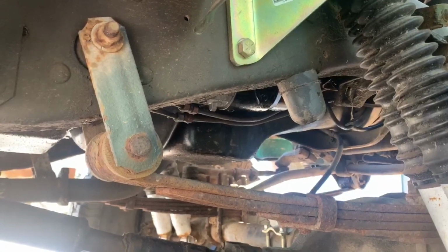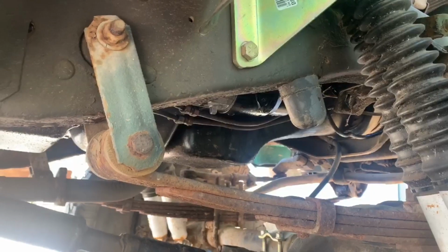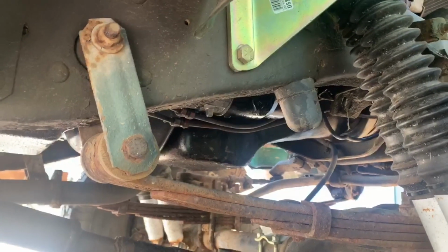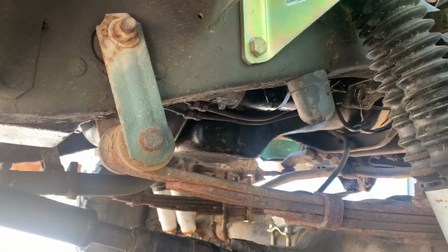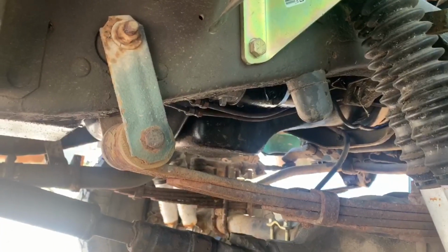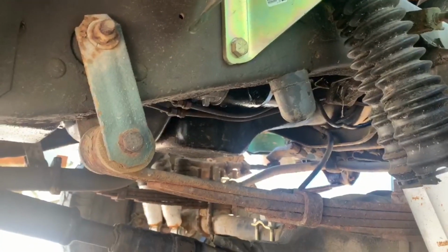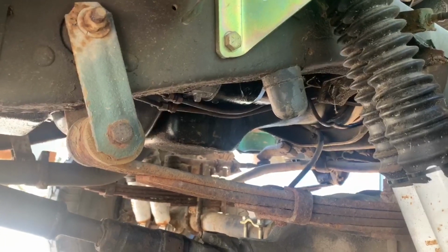When the starter was remanufactured, it wasn't put together right, so it didn't have good contact surface, and we just had some burnt contacts to clean up. Got that resolved. She starts up good now. But ultimately, there's something else that I saw in this thing that really bothered me, and before I run the truck anymore, I need to address it. I will show you briefly.